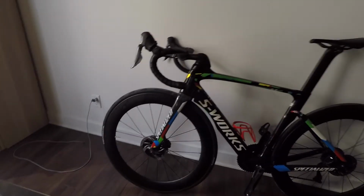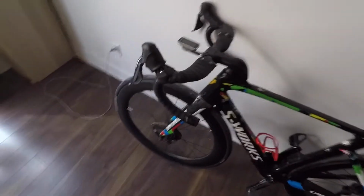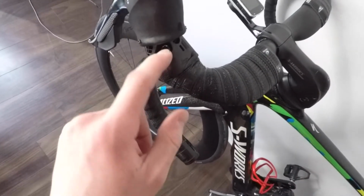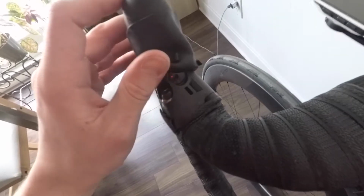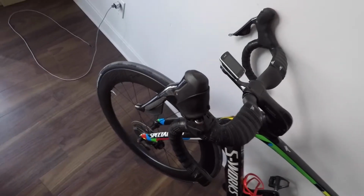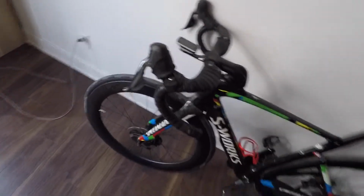Of each and every bolt that I could have rounded, this is probably the worst, because I don't care if this one is rounded. This one can be changed because I have enough room to work around this, but in the bleed port you just don't have room. You have no margin of error whatsoever, because you cannot drill it out. And don't think I enjoy rounding bolts. I just don't. As for the contact point, this is not something that's critical. It doesn't destroy the brake if you can't use it, but a bleed port does.